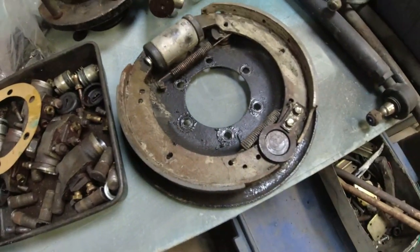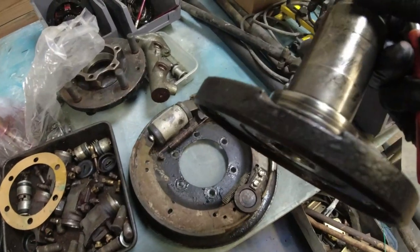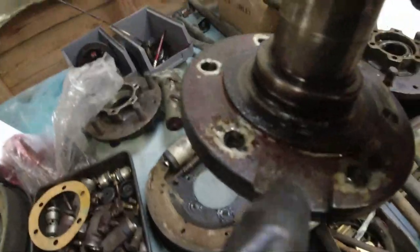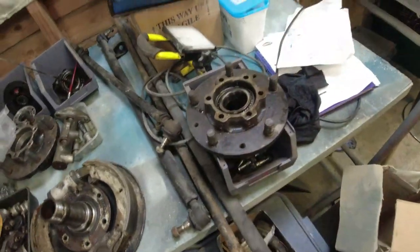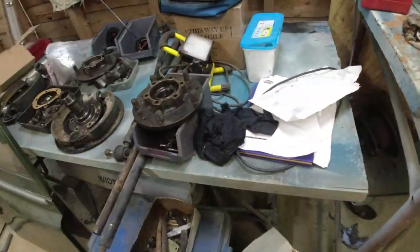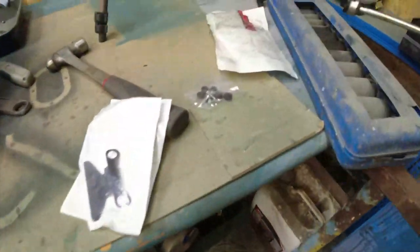Driver's side is in much the same sort of state. A little bit of oil leaking onto the back plate, not as much as the passenger side. The stub axle looks serviceable. You can get it cleaning up. Interestingly, it was upside down, so the groove there wasn't pointing downwards. Hub okay, no issues at all, apart from all the bolts were loose on the drive plate. And then that's what I found in the end